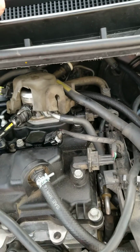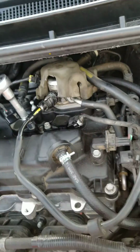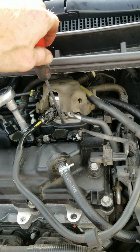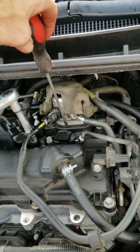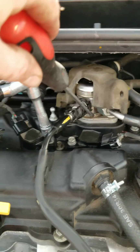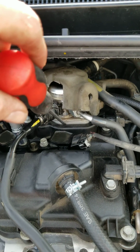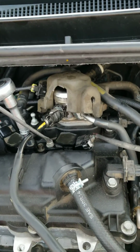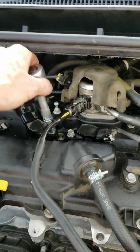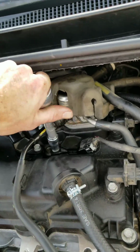Now this one was difficult pulling out. I showed you how to do it. Pretty much the same thing, putting it back in, except when you're putting it back in, you'll come out like this behind it and kind of push towards this pump a little bit. You're not pressing up here around the fittings or anything like that on the pump. You're just down here at the bottom at the base, just kind of using it for a little leverage, pushing on it like this, and then take something to kind of tap this little ear. And now when I say tap, I really mean tap. Be patient, and it'll go in there. It just takes a minute or two. So I'd rather take a minute or two than have to replace something.